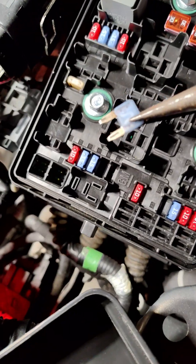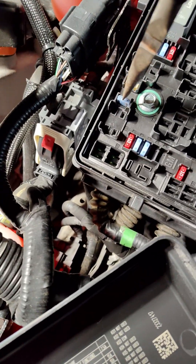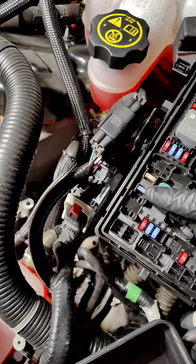If that's the EGR that's your issue — the EGR fuse circuit is shared with the EGR itself and the water pump. No water pump means no coolant moving in the engine. No coolant moving in the engine means overheating. So if this fuse is blown, you're going to need to replace it.